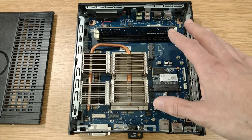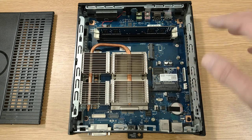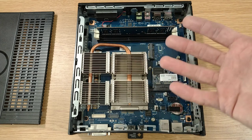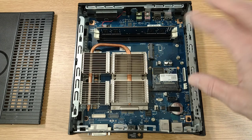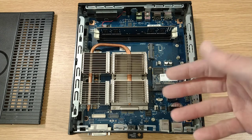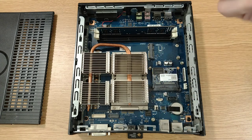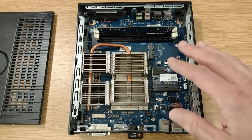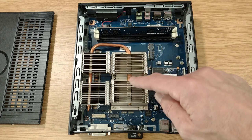Take that Wyse CX-Note, it was running at 1 GHz, which you think, wow, for Windows 98, that's a huge amount of CPU speed. But because it was one of those low power VIA Edens, I think it was, it's not equivalent to a 1 gig AMD Athlon or a 1 gig Pentium 4. It was maybe about half that, if you're being generous. And it's the same with this.